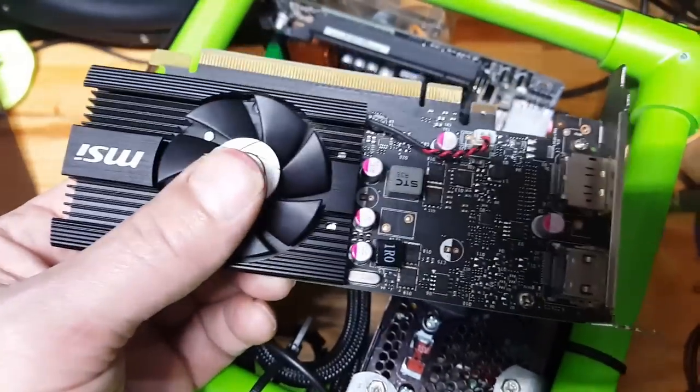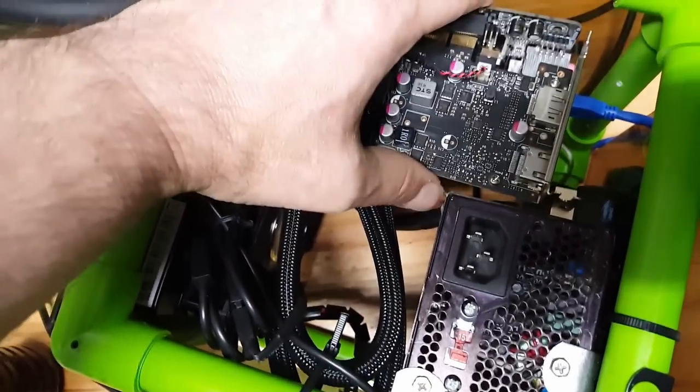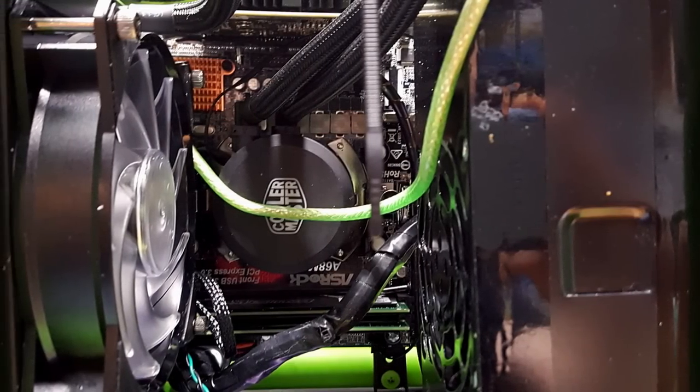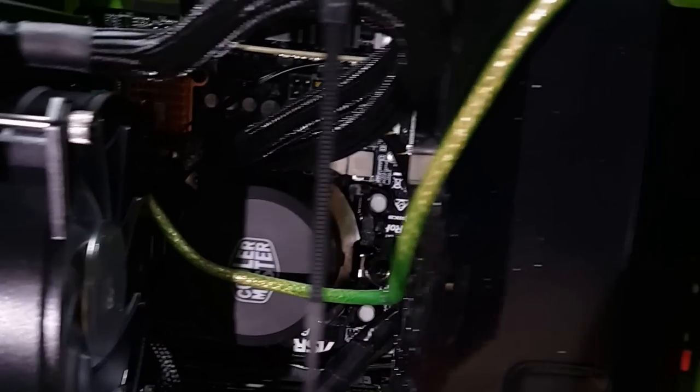Needless to say, I got it all to fit and slapped in a GT 1030. This baby runs cool and runs quiet. It also has an 80mm fan behind the motherboard for additional cooling. I also have a mini SSD, and it holds the operating system. It also has 8GB of 1600 DDR3. I think we should test this out though. What do you think?